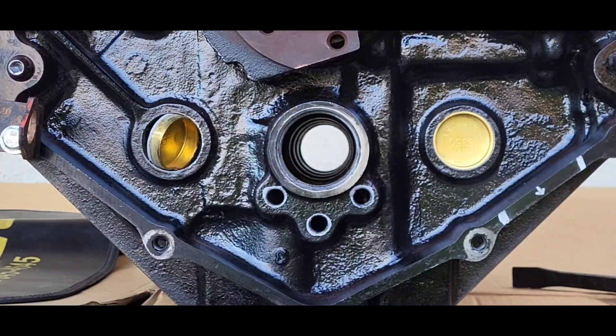That's the cam tunnel between the rear freeze plugs with the rear cam plug removed. We used our one and three-quarter inch diameter by 33 inch long piece of tubing. You'll have to take the block off the engine stand and put it on something to get the rear freeze plugs out.